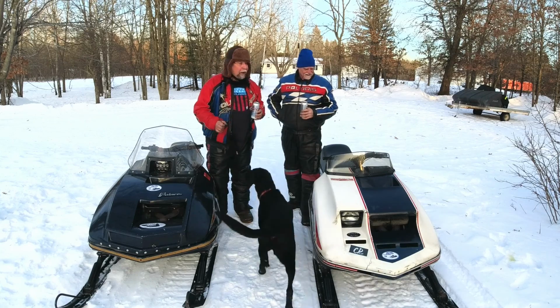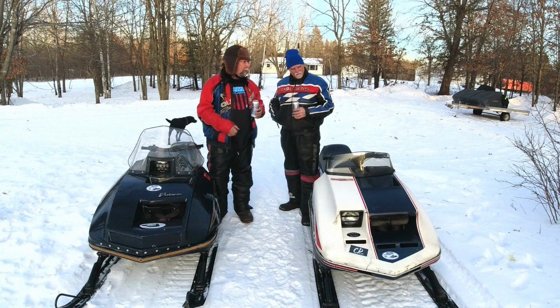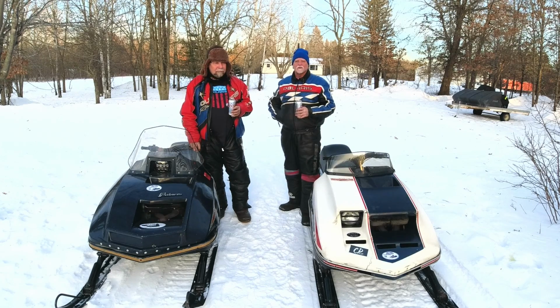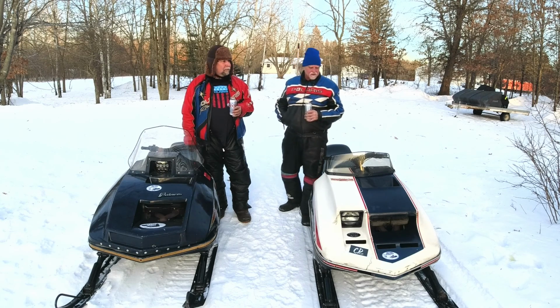Lonnie's sled made it. We had no trail breakdowns. I can't say it was flawless. You want to talk about our issues? We have a few challenges. This thing was stagger jetted. We think it was stagger jetted because previously there was that weak boot on the right hand cylinder.